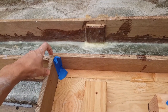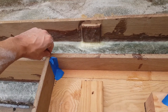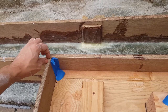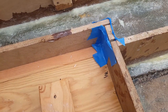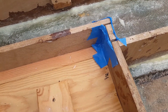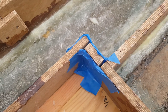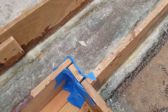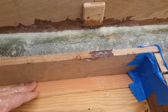What I'm going to do is actually pour some epoxy resin into this little joint. There's probably about a thumbnail's width on that side. I just want to make sure it penetrates down into that little crevice area, since we have three pieces meeting up. You can probably see a little bit more on this side — maybe an eighth of an inch on one side and about the same on the other. I'm just going to take and pour some resin in there so it fills the voids a little bit.